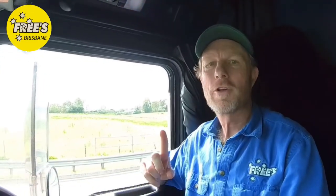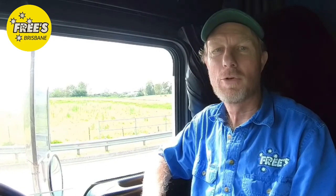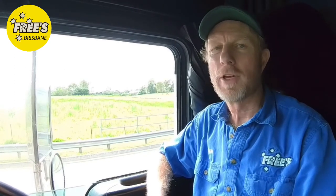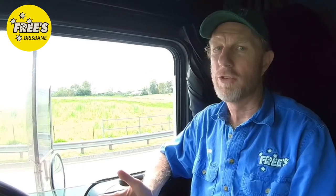Okay, let's go hook up some trailers. But first, there's a couple of things you need to know about turntables, or fifth wheels if you're American. There are two major types of turntables. There's a quick release turntable, or fixed turntable, which is the most common, and there is a ballrace turntable. Ballraces are more commonly seen on cattle trucks, fridge vans, tippers, tankers, but not exclusively.